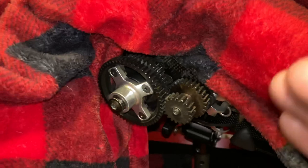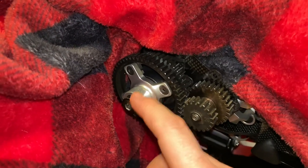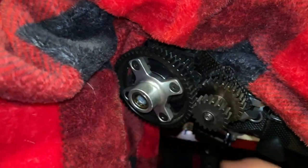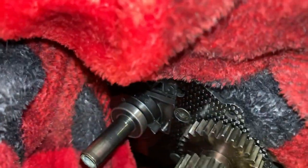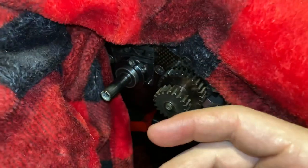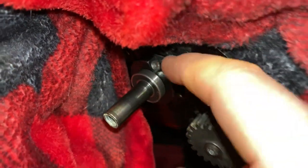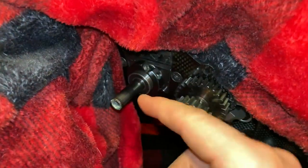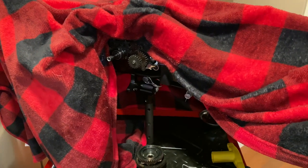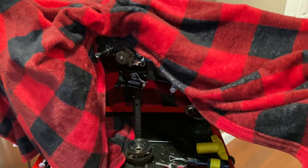When you're out there adjusting your two-speed for the very first time, definitely don't over-tighten this. You may have to adjust your shift points. To adjust your shift points, take this out, take that out, get to your claw, get to that grub screw. If you want your car to shift later, if you want to stay in first gear longer, you're going to have to tighten that to the right a little bit at a time - little turns at a time - keep adjusting it until you get it right. For drag racing we don't want to stay in first too long, but we don't want it to slap into second too quick either. Sometimes if you bang into second too hard your car will get out of control.